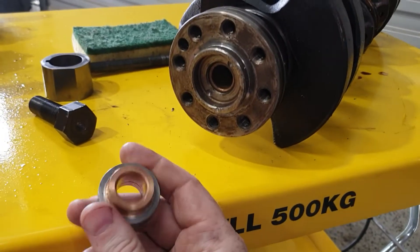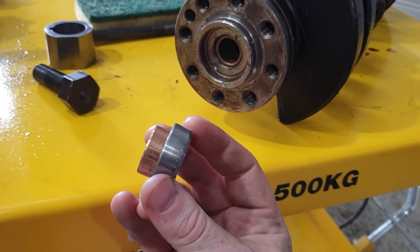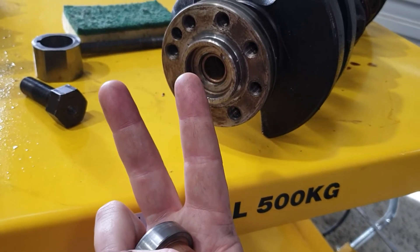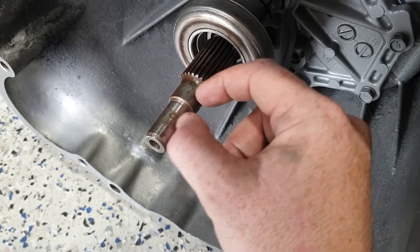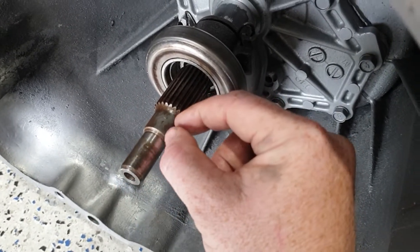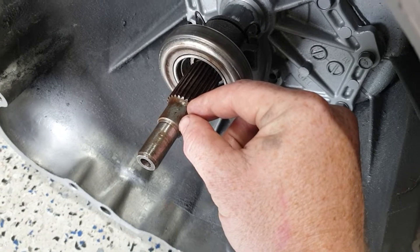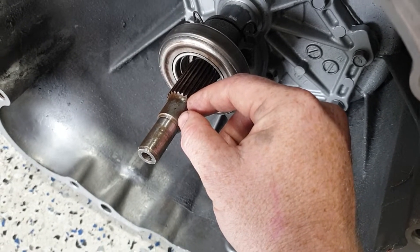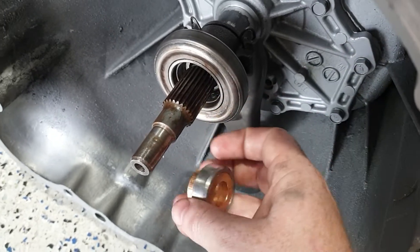Now, that's all good and dandy — but a problem I had. The gearbox conversion states it's simply for RB25 gearbox, but there are two types of gearbox, which is to say there are two different types of input shafts. The input shaft has an engagement area where the spigot bush actually goes on, then a stepped section, then the spline section. In the early series RB25 gearbox, this stepped section is about 20mm.